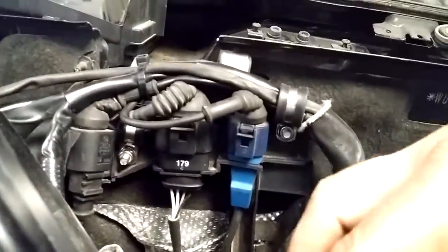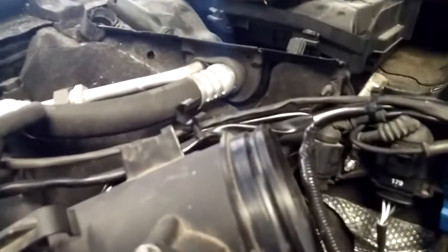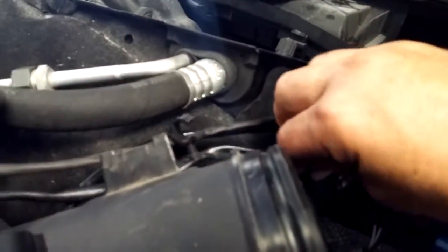The B7 RS4 fuel line actually ends up fitting perfectly without being kinked or any weird routing. It is kind of close to the valve cover, but I am still going to use the plastic valve covers, so this shouldn't be any issues with heat here. Using the B7 RS4 95mm Bosch MAF, so I've converted it to a Bosch plug here, and tried to clean all that up too, so it looks pretty.